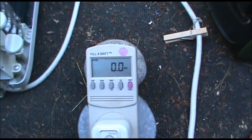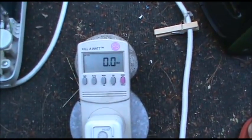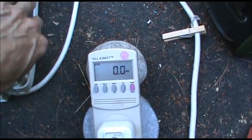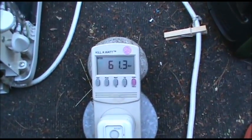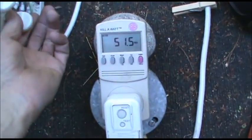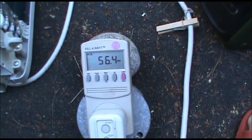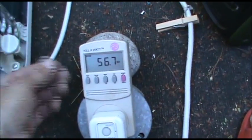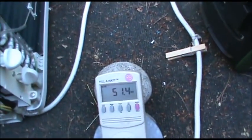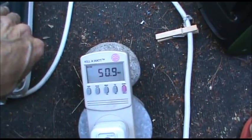After such a dismal failure, I decided it's time to get out the meters and see what we really got going on. Got my little meter here plugged into the air conditioner — they call it a kilowatt meter. Handy little deal shows you how many watts whatever you plug into it is running. First we're gonna turn the fan on. That's low fan — we're pulling 51 watts. High fan: 56 watts. We're gonna kick this air conditioner on and see the wattage jump. Initially these will spike pretty hard to get them started, and that's what kills the generator. If you can get it started and get it running, you're good to go. Problem is getting started.